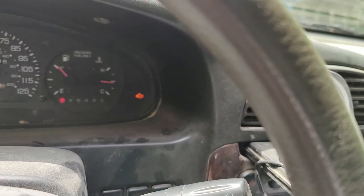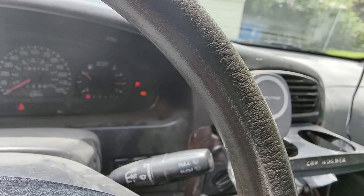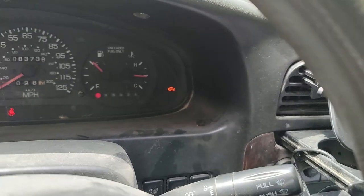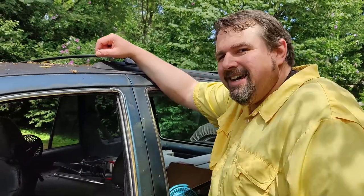The camera seems to be focusing on the steering wheel — there we go. It's behaving better; I think the partial pressure wash took care of it. It was probably just the condenser was clogged so it wasn't letting air pull through. All I can do is drive it a while and see. Today's only in the mid-80s, so if it gets up to the hundreds again it may overheat. But for now it looks like it's fixed — or at least it sure helped.